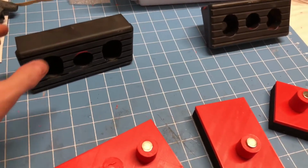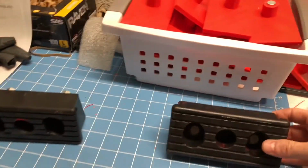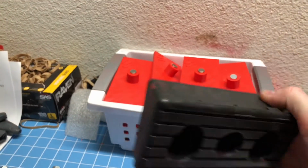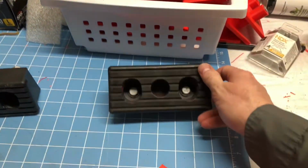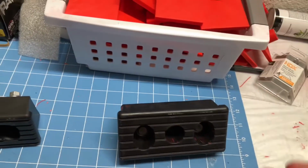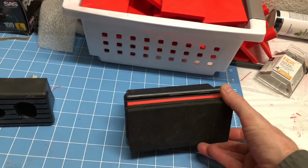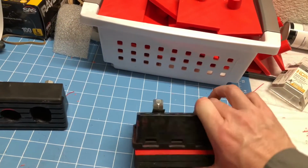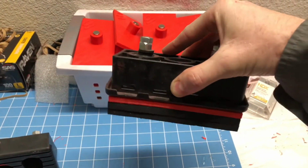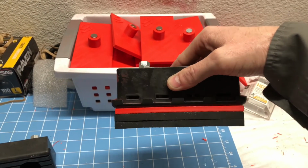Now, on the bottom side of the Tesla to lift on is going to be this component. Of course, it is going to be bolted up inside there, but you see 3 holes right there. This is for the Model S. For the jack pad adapter, you see the magnets. Well, ta-da! Holds onto the magnets. You just pop it in place, and voila, it holds in place so that you have better control to get your floor jack up underneath there.